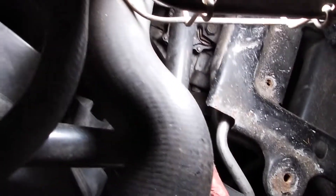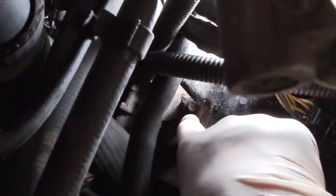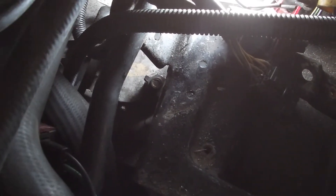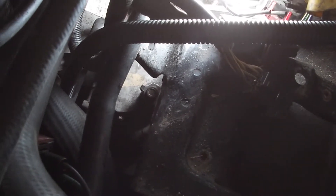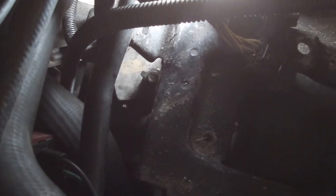The first thing I'm going to do — it's hard to see with the light and where the tray is, I can see why everybody's complaining about it. You see this bolt right here — that is a 13-millimeter bolt which is holding the actual shift lever in place on the sensor. We're going to remove that and gently pull up the shifter so we don't break anything. That should disconnect everything from the inside of the car — from the shifter to the actual shift sensor — and then from there we can go ahead and remove the two bolts on the side that hold the rest of it in place.